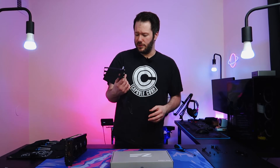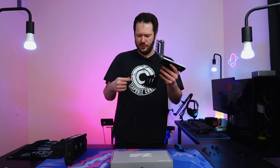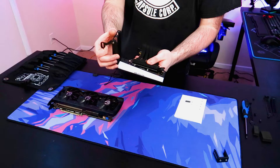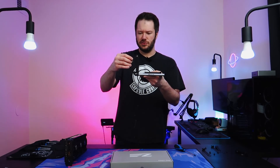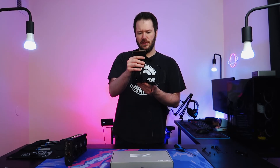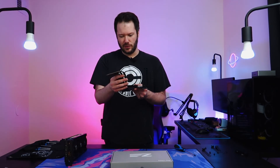Just to go over a few main components that the kit comes with — I already have the bracket set up here. You have your main PCIe slot with its normal lever to load and unload the card. It has an RGB header that lights this little white opaque bar at the bottom. It comes with a couple different mounting options: a bracket that mounts to the side, taking over the horizontal slots and turning them vertical, and then a plate that attaches to those on the front or back side depending on which way it needs to go in the case. This is PCIe Gen 3 only, so we'll have to change some settings in the motherboard since we have a B550 board that defaults to Gen 4.